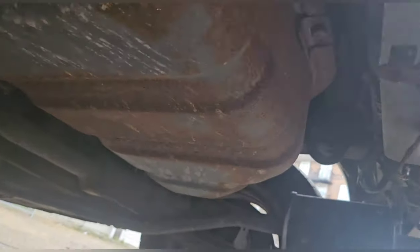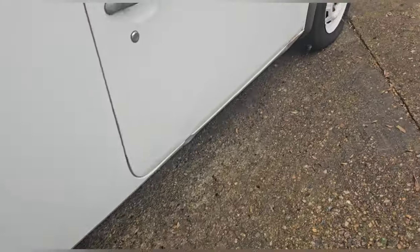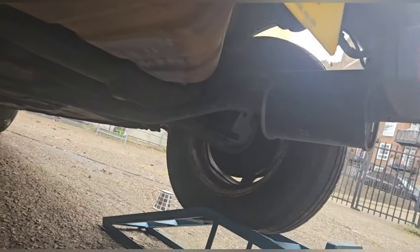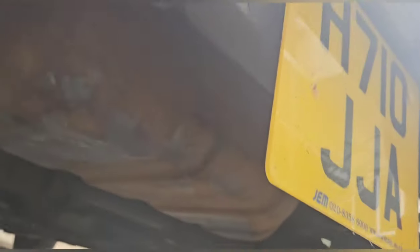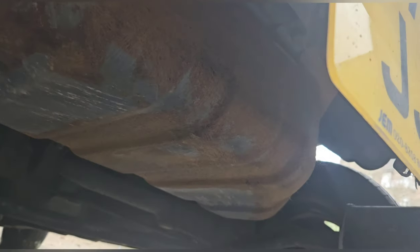This is so cool — look, Nissan exhaust, brand new. I'm happy. I'm going to look online and see what Halfords have, and go and pick some up — while it's up on the ramps you'd be nuts not to. Let me just flake away the petrol tank for now and clean it up. Wire brush and scotch pads take off most of the loose rust. I'm going to give it a good douse with brake cleaner and then black Hammerite to give it a bit of long-term protection. From what little I can see it's pretty clean up there, so hopefully this will give it a few more years.